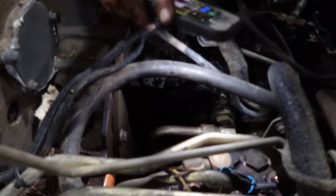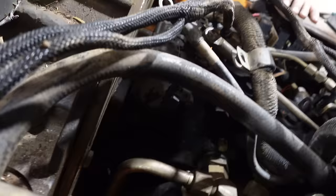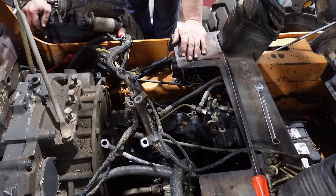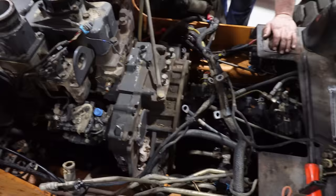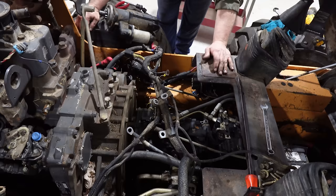There's this angle plate underneath, and it's got three bolts on it - one's really hard to get at. There are bolts going up into the pump too - that's really mean. Two of these bolts are easy to get at but the one in the middle is tough. That's the plate holding it to the bell housing, like the old 1845 C's - you just took those bolts out and the pump fell off with a clunk. But they didn't have the auxiliary pump in the front back then.